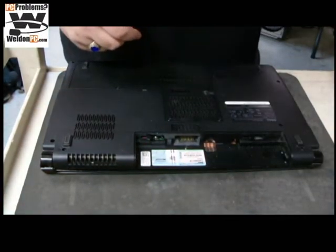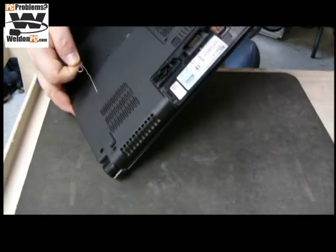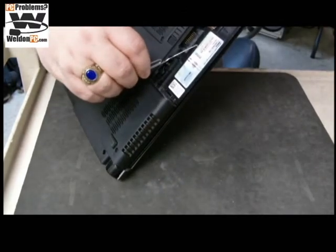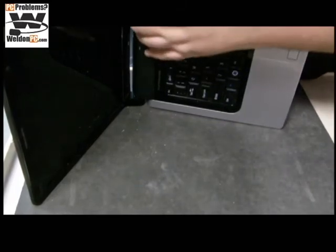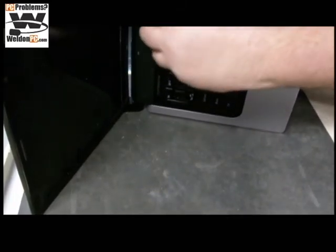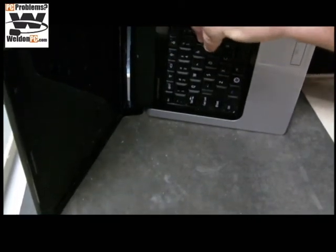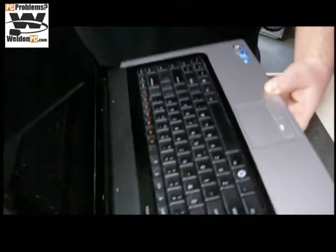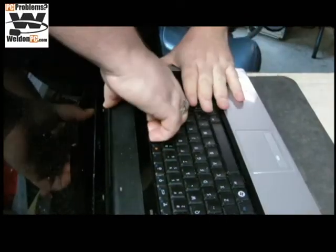The reason I have a paper clip is very simple. When you have the screw hole right here, you open the laptop up and you poke the paper clip through there, and then you'll get some rise out of the component that was screwed down. We're doing that so the part pops up with minimal effort and less chance of damaging the bezel.